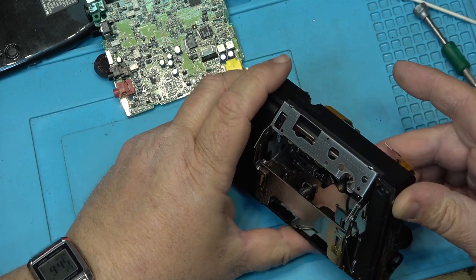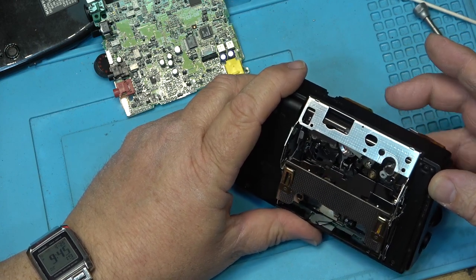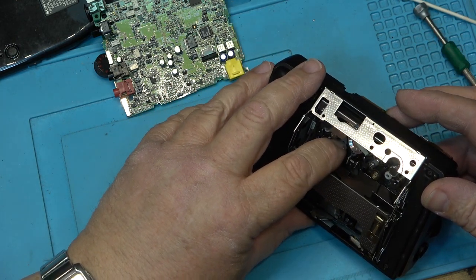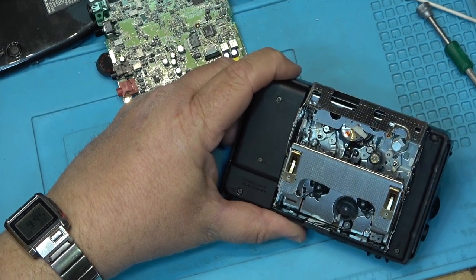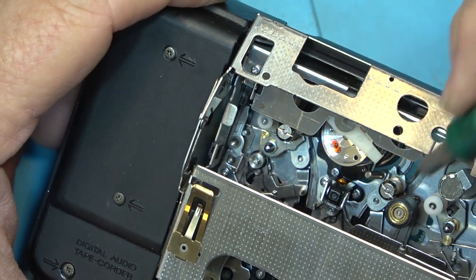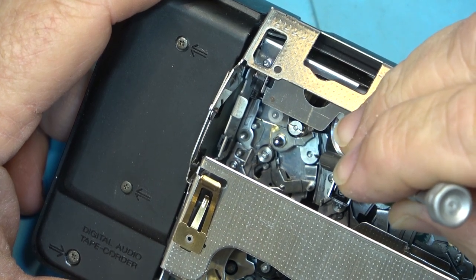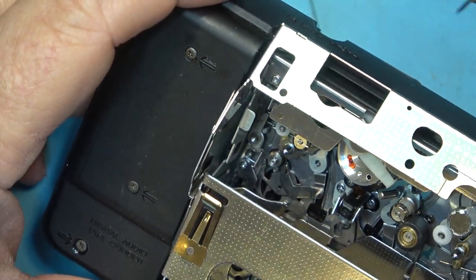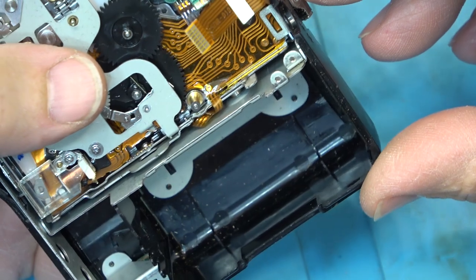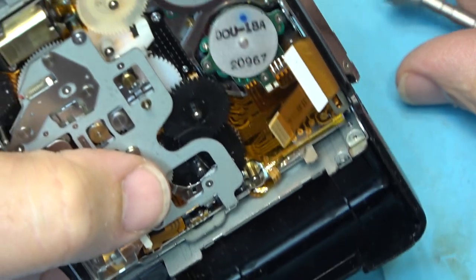Everything is moving very smoothly right now, and that's because I was able to get some cleaner down into this pivot right here. Free up this guide — this arm was frozen. Now everything is turning very smoothly. I'm going to get a drop of oil down in there and try to do it without taking the guides apart. Another one that concerns me is this part right down here — this guide has a tendency to fall off that pin. It almost looks like it's pushing its way down. It should be flush, but this one is down low. I want to try and push this guide back into place because that's part of the problem — it gets jammed. I have to get underneath it, but the problem is it's under this little circuit board, which makes accessing it very difficult.